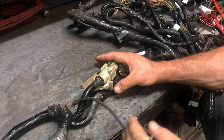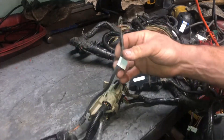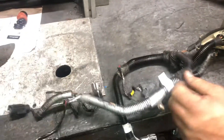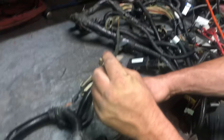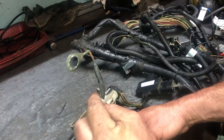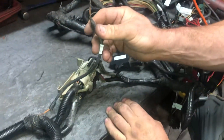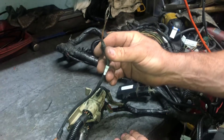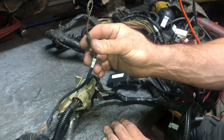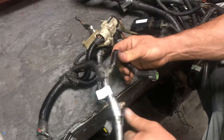I've never had to do that yet — I've been fortunate. After the salt and pepper shakers, attached to the fuel injection harness for the fuel injectors, you're going to see this. This is extremely important. If you don't connect this to a ground, you're going to have massive issues. This always just gets connected to the bell housing bolt right in the back of the motor — usually the first bell housing bolt up top on the driver's or passenger side.